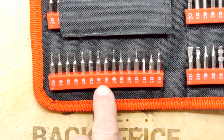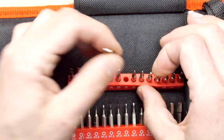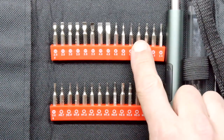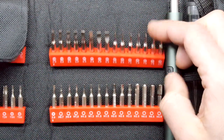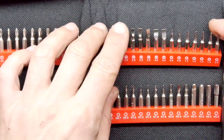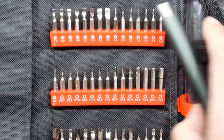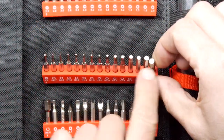Then your flats — you've got a lot here, ones and twos, right up to a size 4. For consumer electronics and benchtop electronics, you're not really going to see much action from the larger slots. Then you've got your star drive — don't confuse them with Torx. The Torx have six ends, whereas the star only has five, so that's actually super unusual to see those — security screw territory. Then your hex, which are really useful so you don't have to get all the other Allen keys.